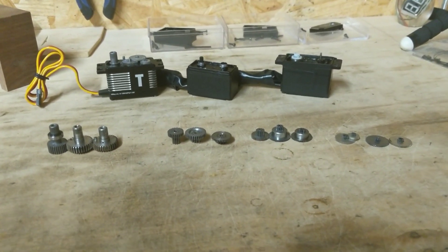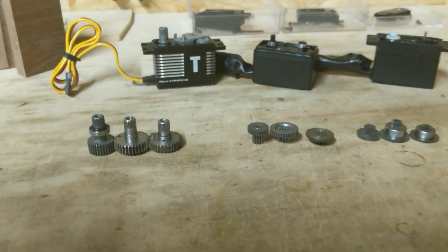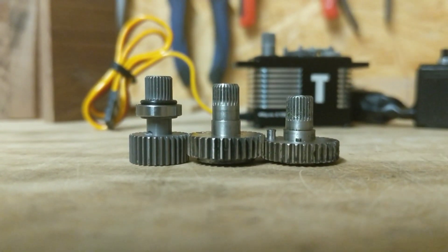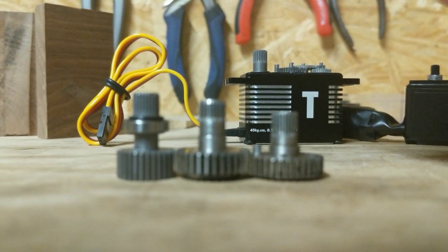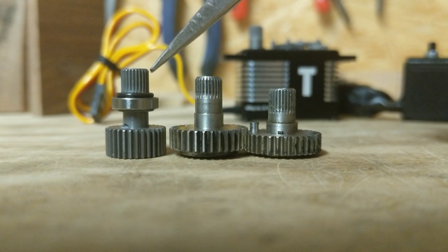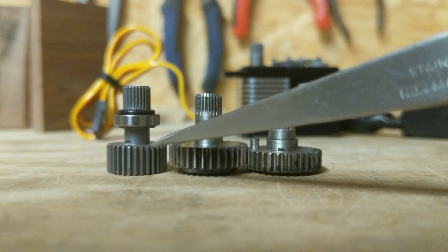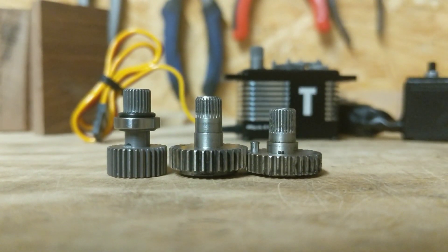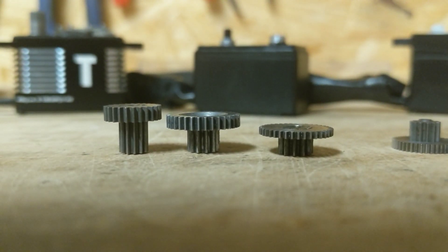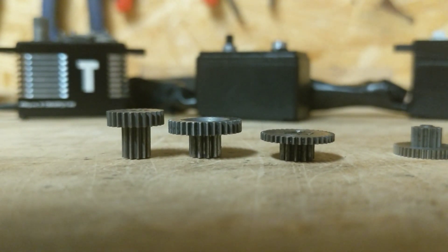Now looking at the gears, we can see the next point of strength. Along with removing the stacked gears and that extra long pin that can deflect, we also have much taller gears. Starting with the last reduction, which is also the output gear — here's your Model T, and here are your other two. You can see how much taller that tooth is, which allows it to be a lot stronger. Moving down to the next reduction, again Model T on the left, and still we have more meat.